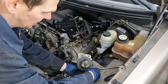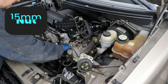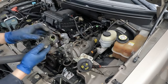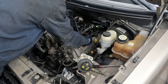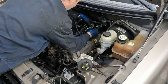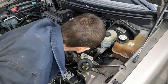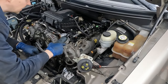Bungee this out of the way and keep moving. We can unplug this, unbolt this 15 millimeter. There's a little green tab you just push back and it pops off, same on the manifold - just a green tab here. Unplug our VVT solenoid, coils, and injectors. This harness is clipped onto the valve cover; pull that off and get it out of the way.